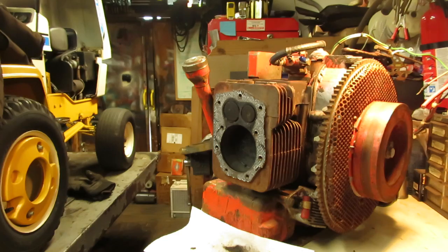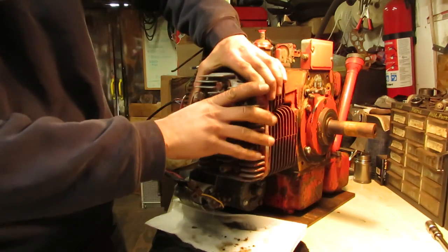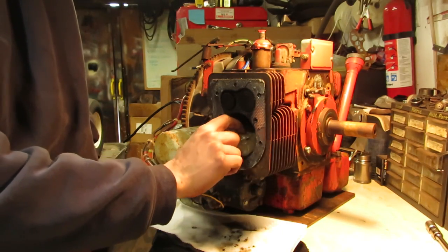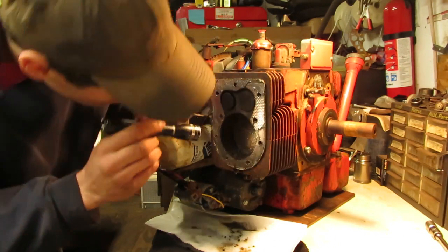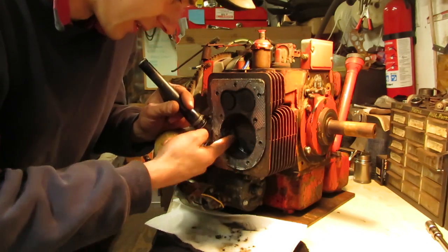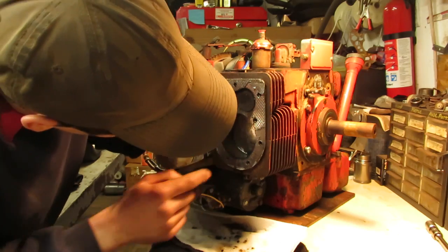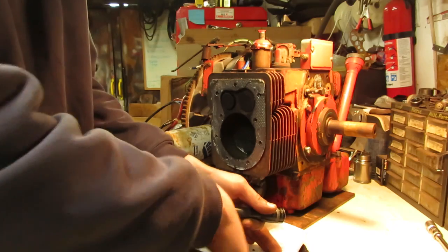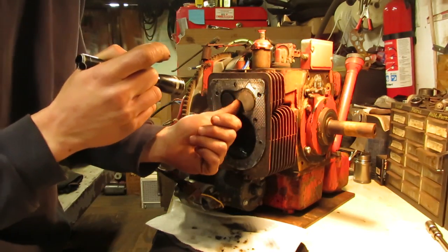This one's got a lot more water in it — a pretty good sized chunk of ice too. There's a fair amount of surface rust but nothing that won't clean up. My biggest concern is the tops of these pistons — they're pretty well carboned up and I'm just hoping this isn't a smoker. We'll find out soon enough. I'm going to start scraping these out, see if I can get this engine to move because it is a little stuck from sitting with this water in it, get these cylinders cleaned up, and see about getting those valves to move and clean up the valve seats the best I can for the time being.